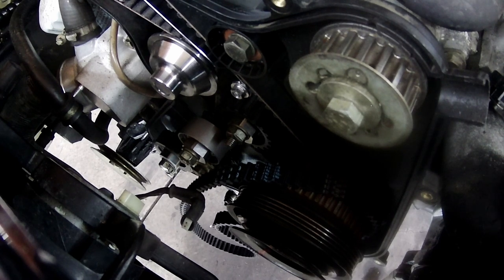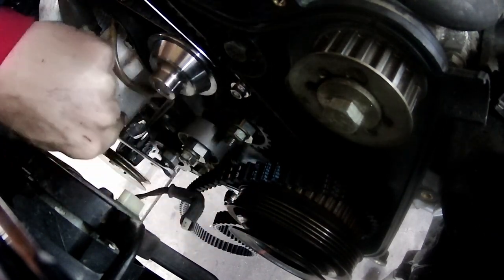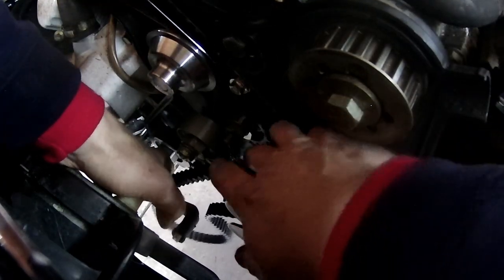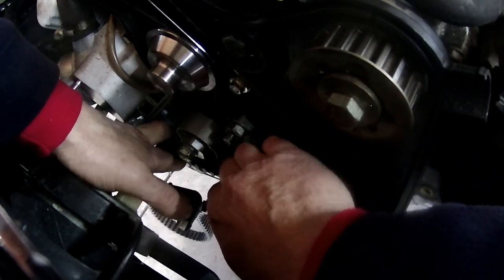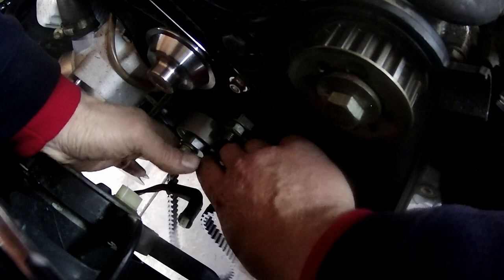Remember, the O isn't the mark — it's the notch in the back of each of the balance shaft gears. Once you've confirmed the timing marks are correct for both the timing belt and balance shaft belt and the tension is sufficient, you can unlock the flywheel and rotate the engine at least two turns of the crankshaft. Go slow at first, and if you encounter any resistance, stop. Bring the cam gear up to top dead center again and check the marks. If it all looks good, it's time to set the final tension.